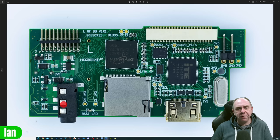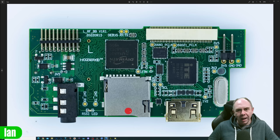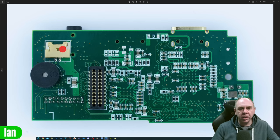On the left-hand IO board there's a bit less going on. We have another DiviMath transceiver taking the signal from the RF front end via the connector on the back. This time we have an HDMI receiver rather than a transmitter, as this is the HDMI input. We've got a crystal, our analog AV input, and our SD card. On the back there's a speaker and a fan control output. Overall there's clearly a lot more going on on one board than the other, but they're very similar in layout.